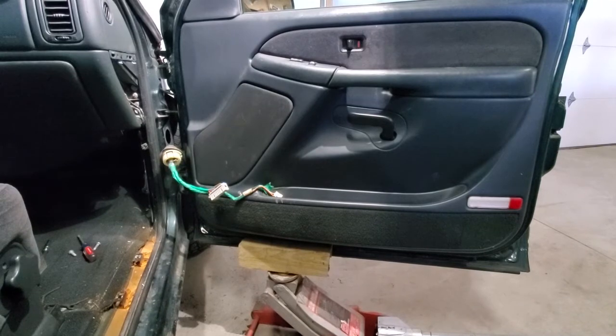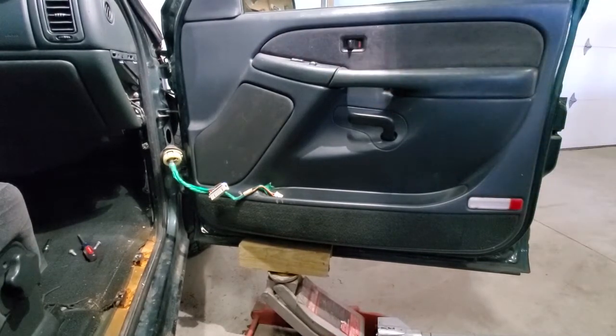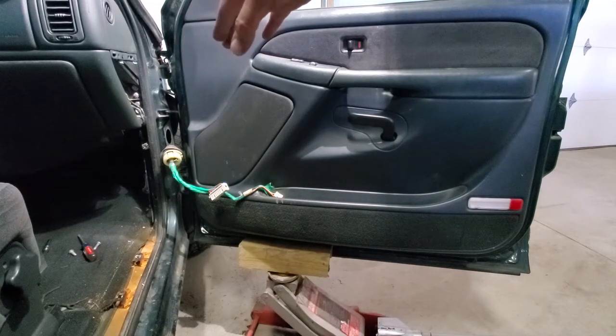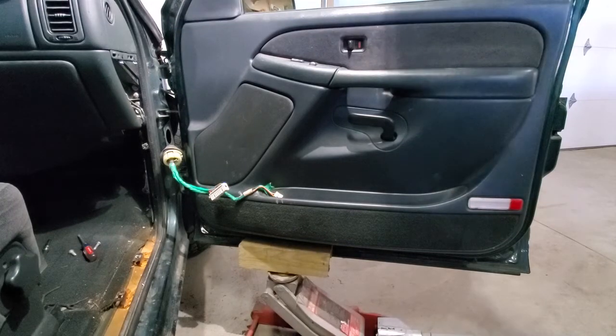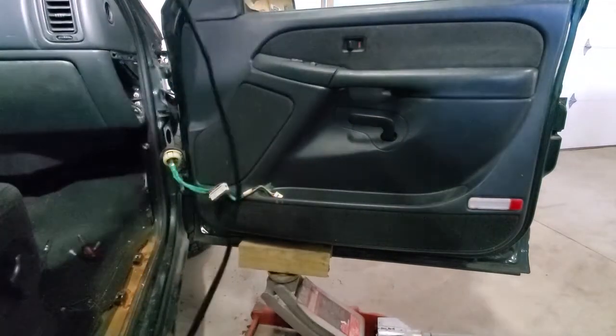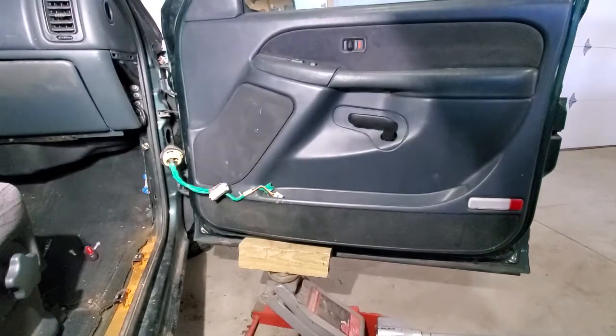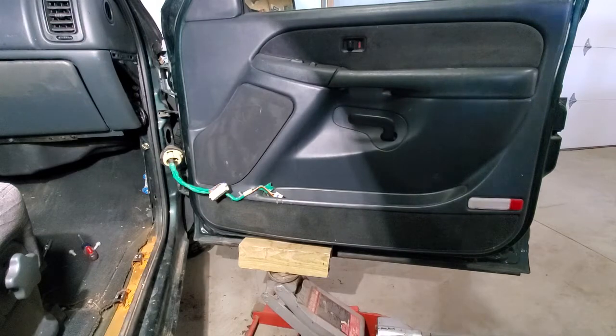And what you're going to see is I'm going to jack a few times. I'm going to check my action over here on the pins to see how I'm coming. And when it's close, I'll stop jacking. I'll just wiggle the door. It'll pop loose of the pins, and I'll just be able to lift the whole door clear. I'm going to move my light because, you know, I can't take the light with me. There we go. And let's give her a try.